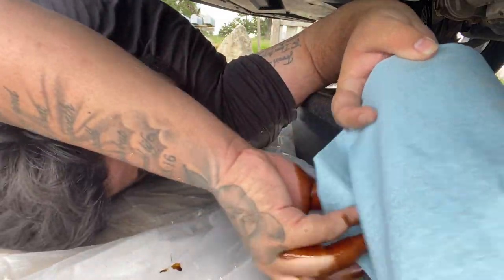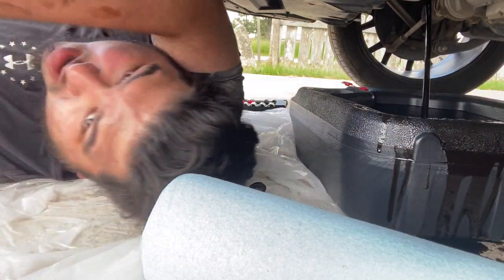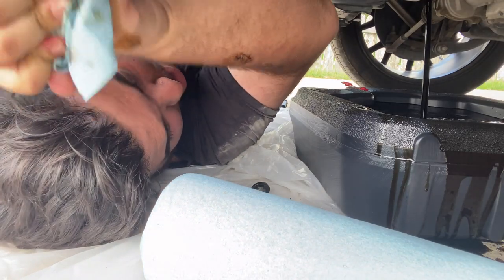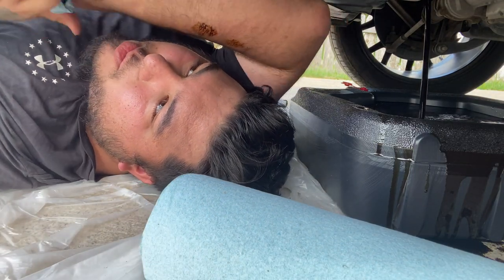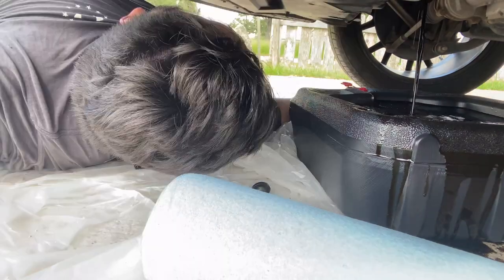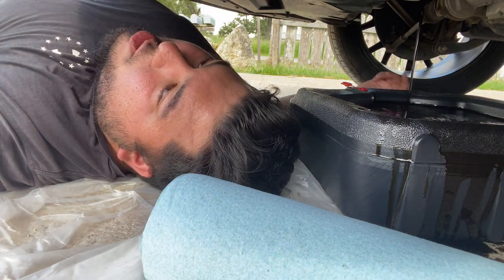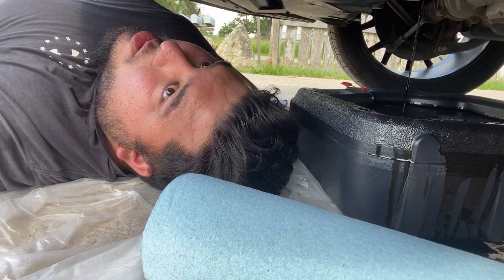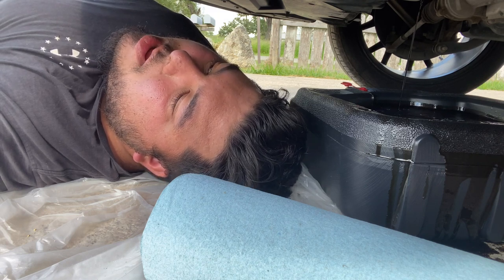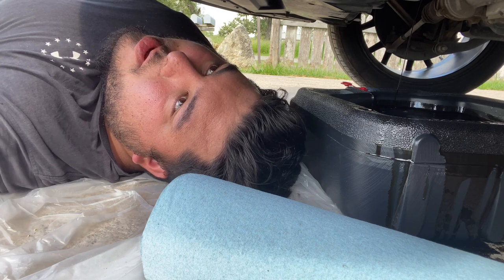Didn't burn myself, but it would still make a mess. Gloves would be really nice, but I checked the price on nitrile gloves and they're freaking expensive — they're like triple what they used to be. Now we'll just let this drain. If you're using one of these drain pans, make sure you open up the little breather valve — it's the small hole on top with a cap — so it can breathe and doesn't overflow. Also make sure the drain cap on the pan is closed, or it will spill everywhere.